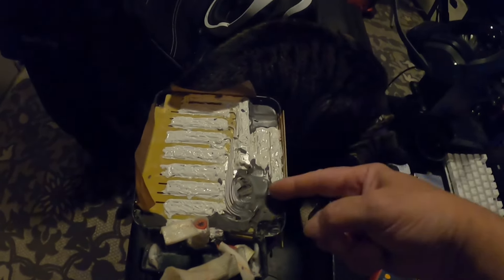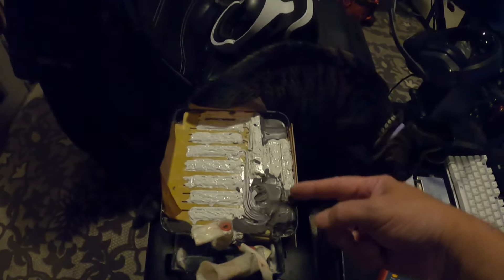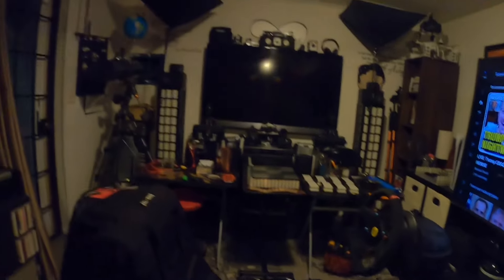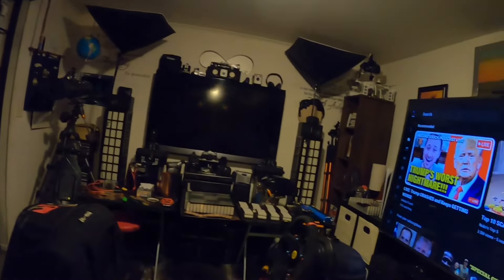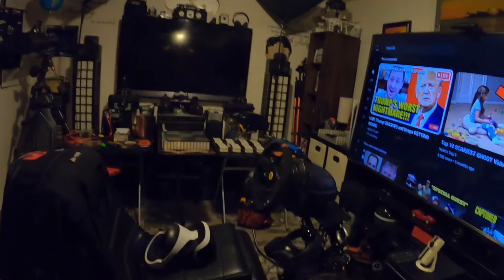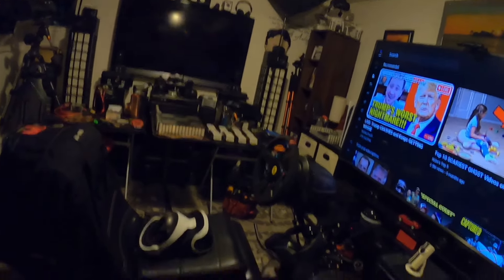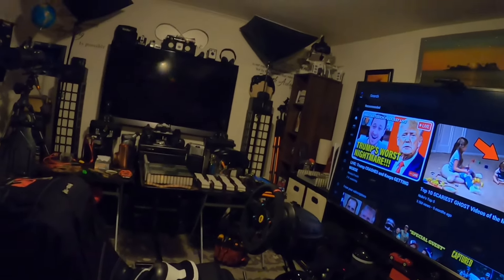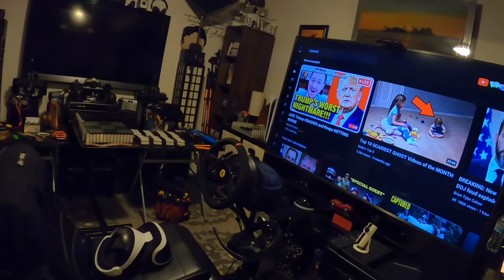When they're potted like that, if you don't know what these bus bars are — that is the main bus bar for the ground right there, and the positive bus bar is underneath there, underneath that silicone right there. If I was to scrape that off, I could put the leads right there. But that's it — that was just a quick, fast way to show you guys how to do a bypass on one of these potted EBMX batteries, whether it has a blown BMS or you're just going to bypass it.